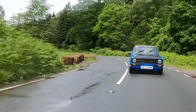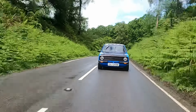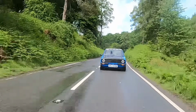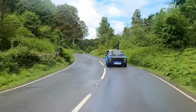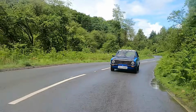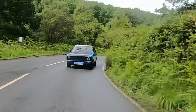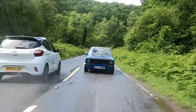It's a sport where you've got to think about, because it's not just round the track, how can I make my car launch off the line better. If I change first gear ratio or the diff ratio, will it give me more? On the gear ratio, what you don't want is to be 100 yards short of the line having to do another gear change. You want to be topping out just as you're hitting the quarter mile. Ideally, you want the shift light on just as you cross the finish line.